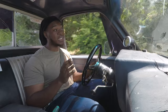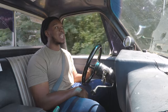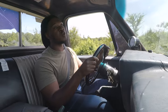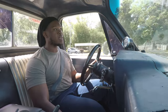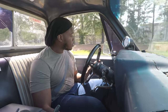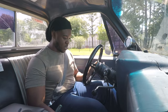The other transmission was completely stock — no shift kit, no stall. Now we got an 1800 to 2000 stall in here and a built transmission, so we're going to test it out. We're testing out theories, guys. We're going to make a small shakedown in a few seconds — y'all hold tight, let me find a good spot. We're going to test it out with a burnout first. I hadn't done a burnout or nothing in this truck yet with this stall. I still got 256 gears, so I know this is going to be a little difficult. Y'all hold tight, let's see what we got.